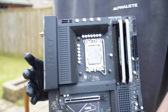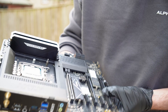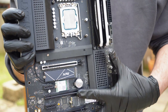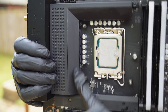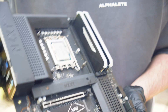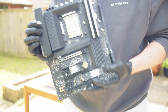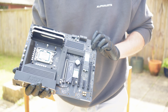Here's the motherboard - looking alright, you know. I'm wondering whether this is where the problem is going to be. The M.2 SSDs are going to be completely fine. Really all I can see is just a bit of scratch here, but that actually comes off. There were a few trickles of fluid along here. So what we're going to do is probably take off all of the heatsink bits and everything, strip it down to its bare PCB, give it a good clean, let it dry thoroughly for at least 24 hours, and then see where we stand.